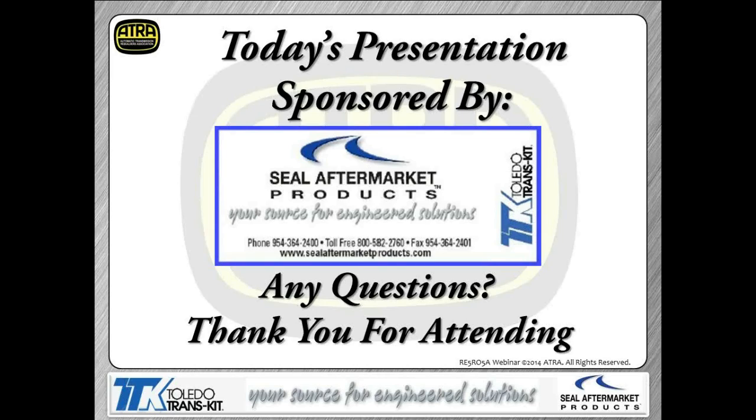These are your torque specifications for the whole transmission. What I found so far is there's 4 different torque converters for these vehicles. Some will have 4 bolt pads and one of them will have 6. The one that takes 6 bolt pads is usually for Kia applications. And as you can see, the other applications here are for the ones with 4. Now you'll notice that all 4 of them are different heights. So you have to be careful when your supplier drops off the converter. Make sure you check it against the core before you release the core to them.